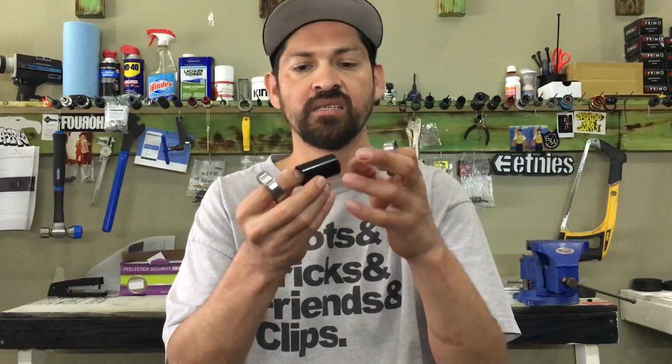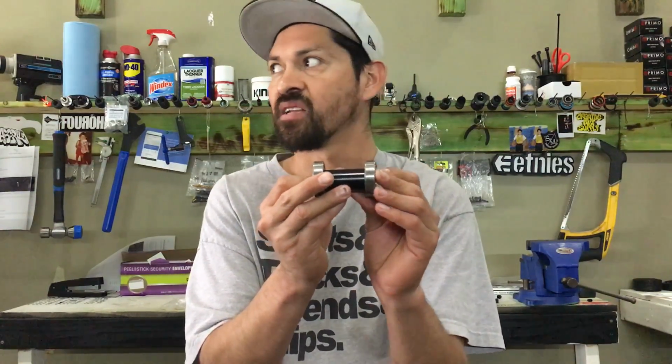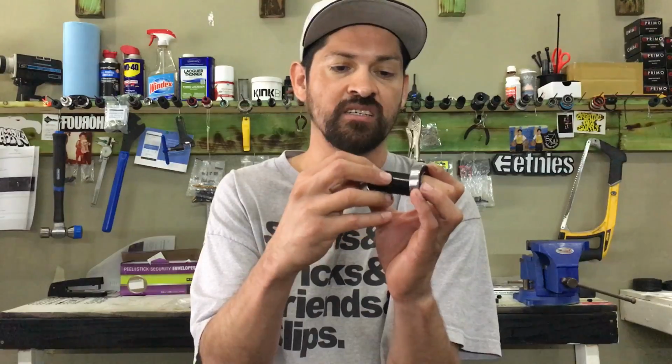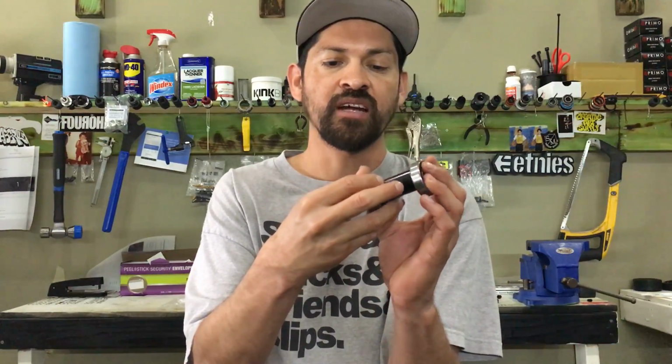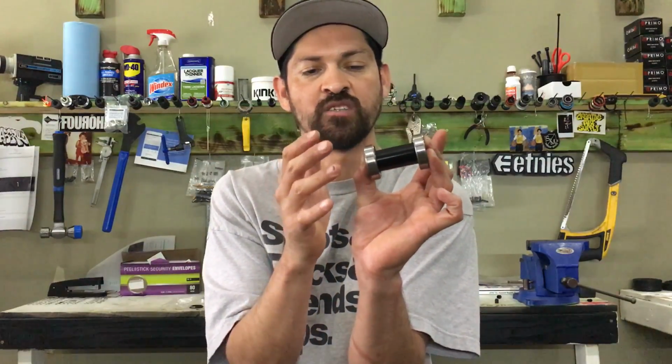What Primo has done is give you this tube spacer to ride in between. The reason your cranks aren't staying tight and don't spin is that you're putting side load on them and there's no tube spacer to stop it. With the tube spacer there, you can clamp it down as tight as you want, and the bearing's never going to get any side load. All it does is secure the arms to the cranks, and your cranks will have the ultimate spin.